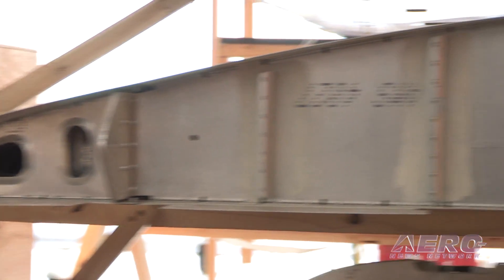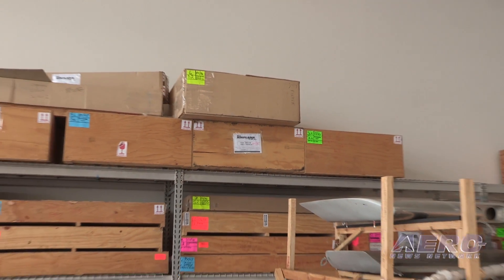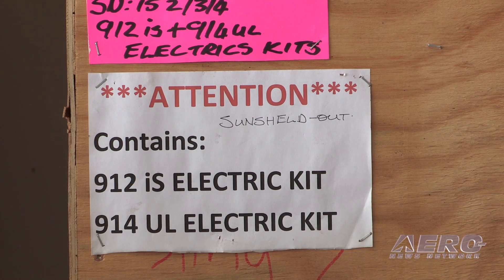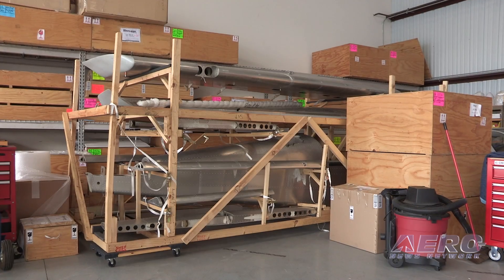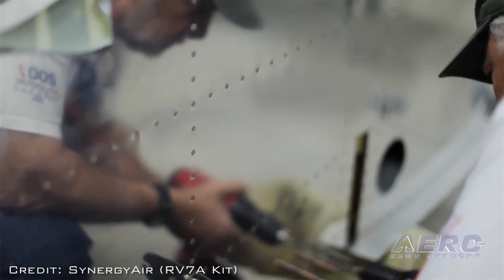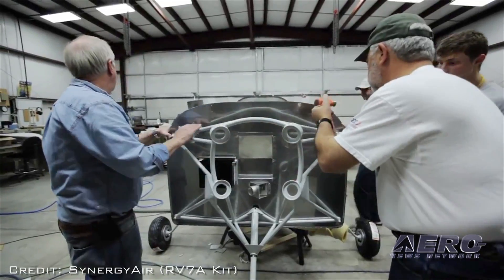The quick build will basically save you from the tedious and very repetitive minor tasks, like putting in 18,000 rivets. The spars come pre-riveted from the factory — even the regular kit has the spars pre-built. Essentially, you get the wings and fuselage in a state that looks very complete, with most of the riveting done, and a very complete wiring harness you can literally lay in and start plugging connectors into. What's left for you is the engine installation, firewall forward, finishing the wings and fuselage, doing the empennage, flaps, and ailerons — some riveting that gives you the experience to understand the construction and earn your repairman certificate — plus pre-built panel avionics options you can simply place in.